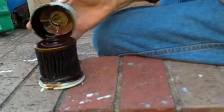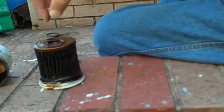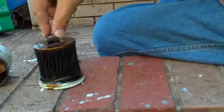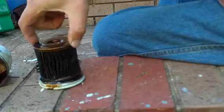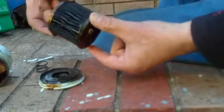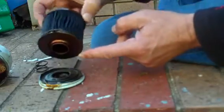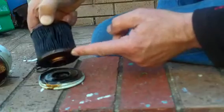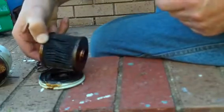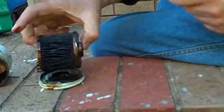And we see inside — this is quite a dirty one because I hadn't changed it for a long time. Lo and behold, it's a paper filter. There's a spring that pushes it down against the base. And there's the paper filter — this one is very, very blocked up, filthy as you can see, full of gunk. So not much oil would have been passing through this one.